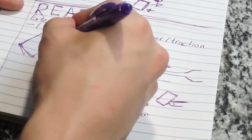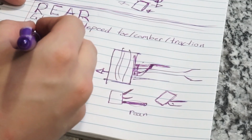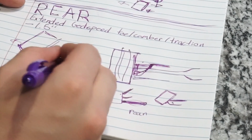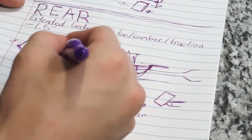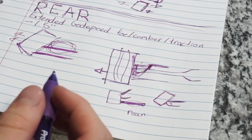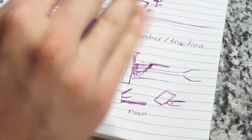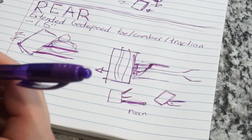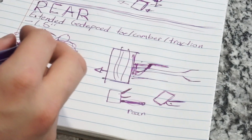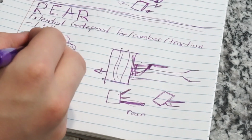Because if you see, great, now you got this tilted wheel, this middle part here, the axle, starts to get pulled back a little bit because it's pushing out so much from the bottom here with the extended camber and toe links and stuff, that now my axle was getting pulled as well. And I didn't have it extended, and I didn't have spacers for it. On top here, there is a ball joint, and that ball joint can move pretty freely. I think eventually I'll blow the ball joint if I do too much camber, but I'm not super concerned about that. So my axle was getting stressed because now it's at this weird angle that it doesn't like,